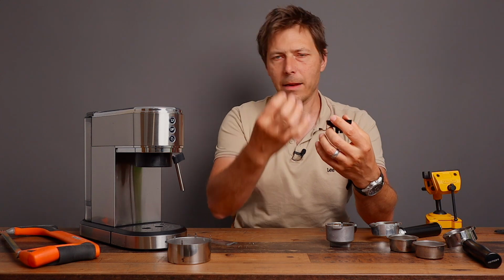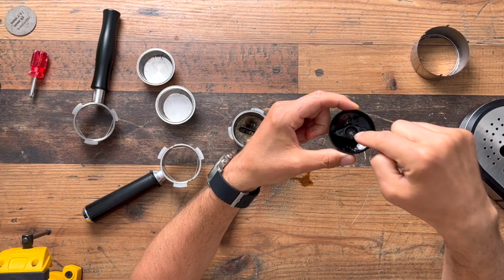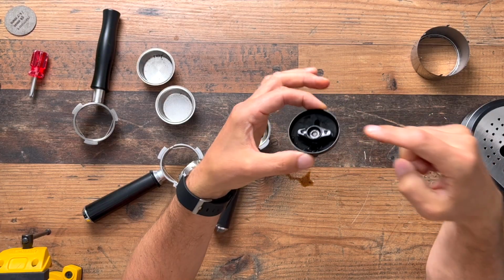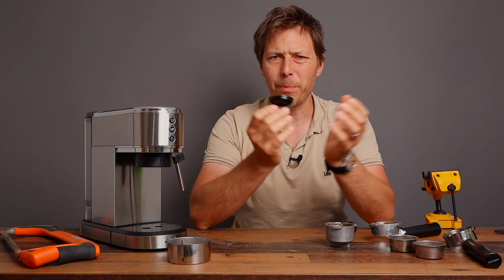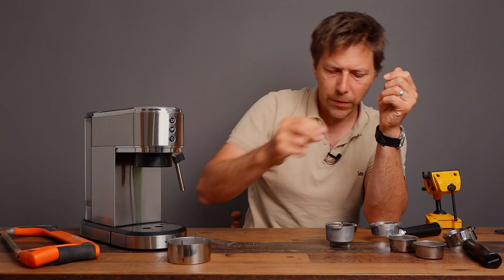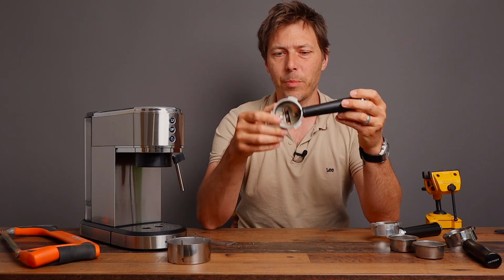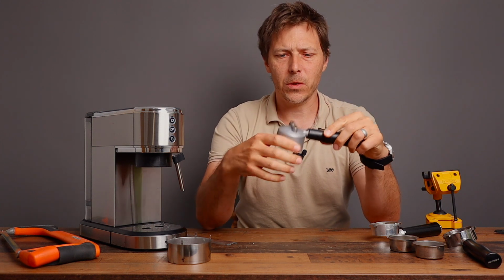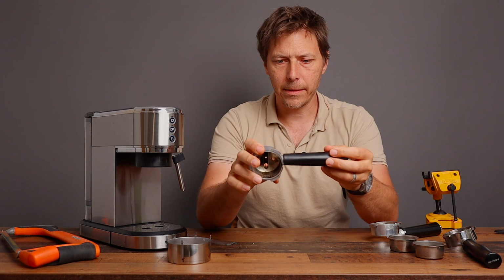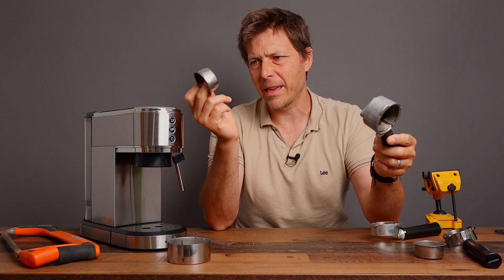That's gross. This plastic piece is in there. First of all, you've got hot espresso coming down onto the plastic, not great. And it first gets diverted through this mesh filter and then distributed somehow down here through the holes. All in all, let's just bypass that whole thing. Put that over there, and this is what you're left with. This is the aluminum portafilter. It is pitted, it is kind of gross, and what we want to do is just cut the bottom off so that we can use this as it was designed to fit in the brew group, but use this sick IMS filter.